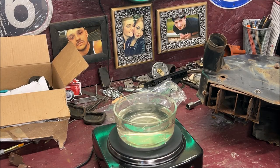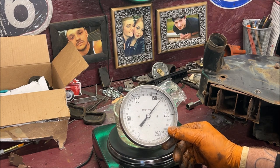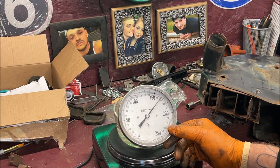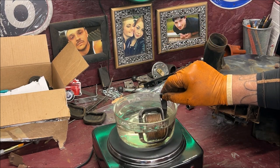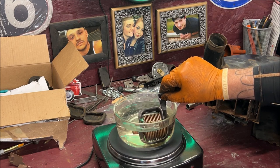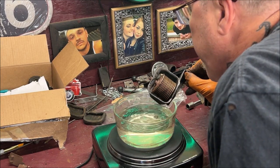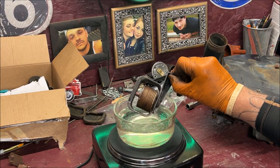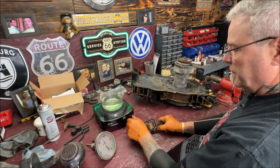Let's check the water temperature one more time before I finish out this video. I was letting the water cool down a little — it was way too hot. We are at 158, 160, 162, 164 — that's perfect, about 165 degrees. Let's check again and see how it's expanded. Let me blow on it and see how quick it'll contract. That is a properly functioning thermostat.